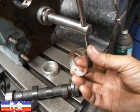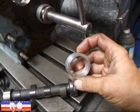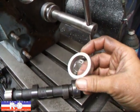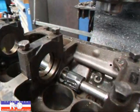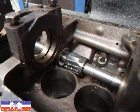The 850 cam bearing, as you can see, is rather thin, and the bearing that I make to be able to do this modification is rather thick. It still has to be line bored, or line reamed as they say, to make this modification complete.